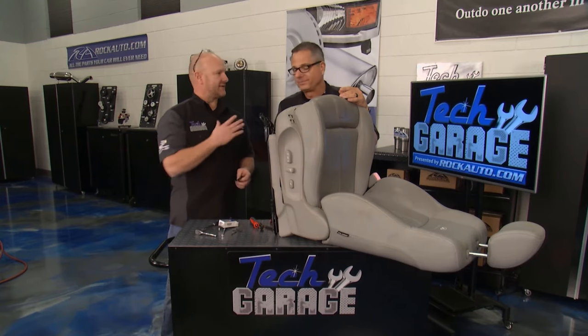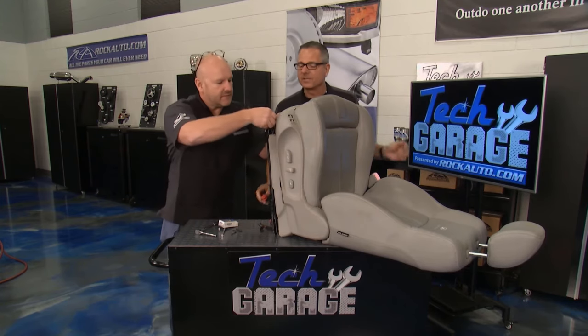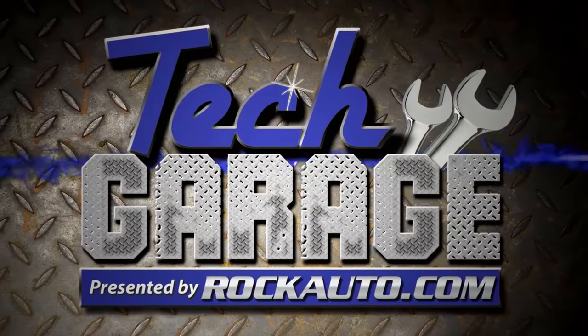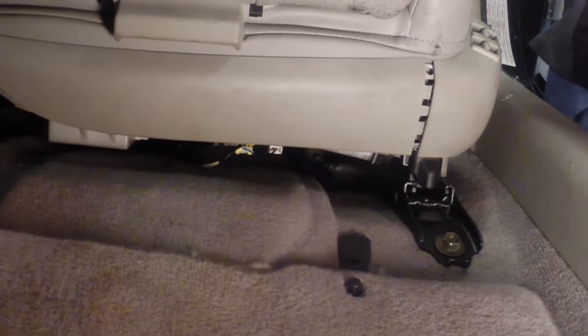That's at least a seven hundred and ninety-six dollar ROI. Good work. So it's just a matter of putting the plate back on, the washer, and getting it torqued down. All that's left is to put it back in the car. There we go — that's the final of all four mounting bolts. We got the framework reconnected with the vehicle so we can test the seat motors. If there was any play there we could damage those seat motors or actuators.